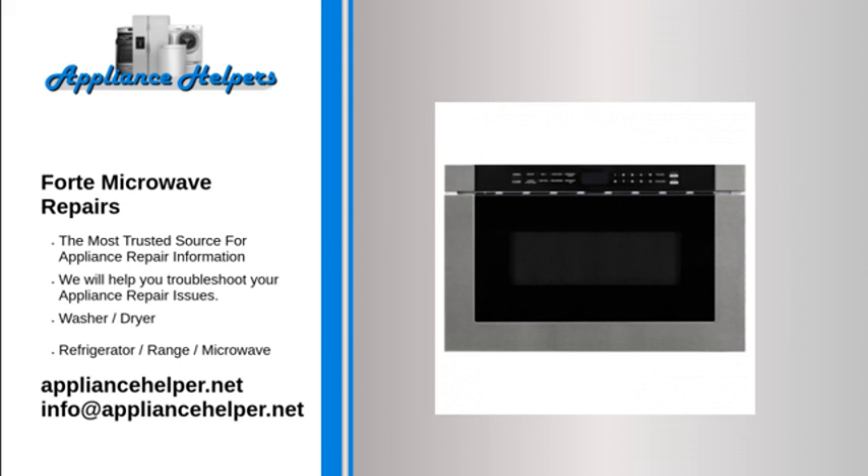Weird noises. While it's true that the microwave is not known for its silent nature, noises other than beeping could mean something's amiss. If your microwave is older and is making loud or strange noises, the turntable might need to be replaced — look online to find the make and model. If you hear a loud humming sound, it could be that the exhaust fan might need some attention. A high-pitched noise while the microwave is in use means there's a good chance the magnetron tube is failing. If the exhaust fan or magnetron tube are the culprits, you will need to call a local appliance repair service.